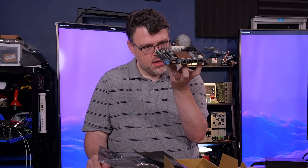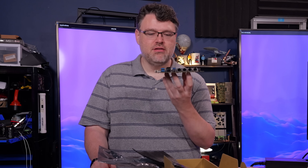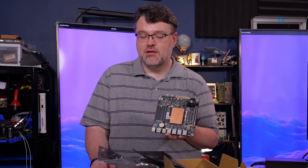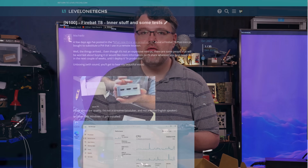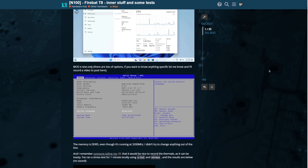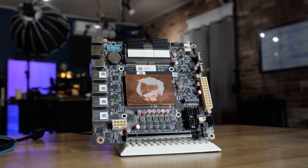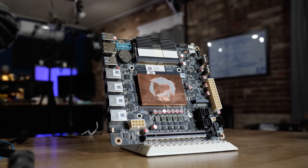This might be the ideal platform for a powerful home router slash home firewall with stateful packet inspection — or maximum overkill because it's eight cores, 16 threads. Like the Fire Bat T8 is really popular on the forum because you can do some really creative stuff with it and it's $150. But with this, because you've got the eight onboard SATA ports, you could avoid having an add-in LSI controller for discs if you're happy with up to eight discs, saving about a hundred dollars.